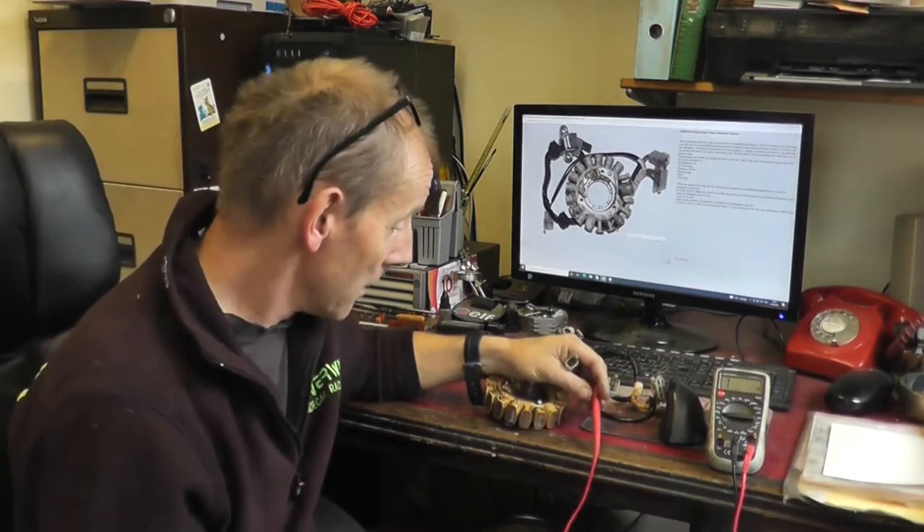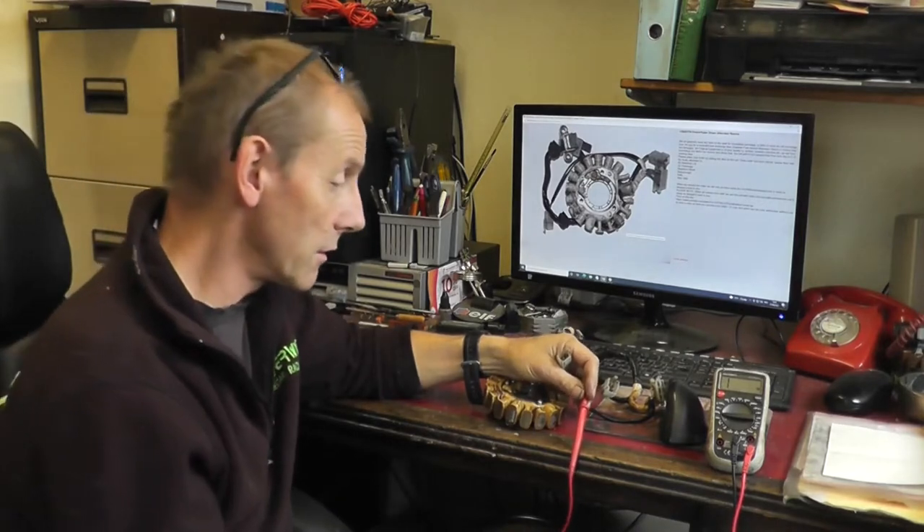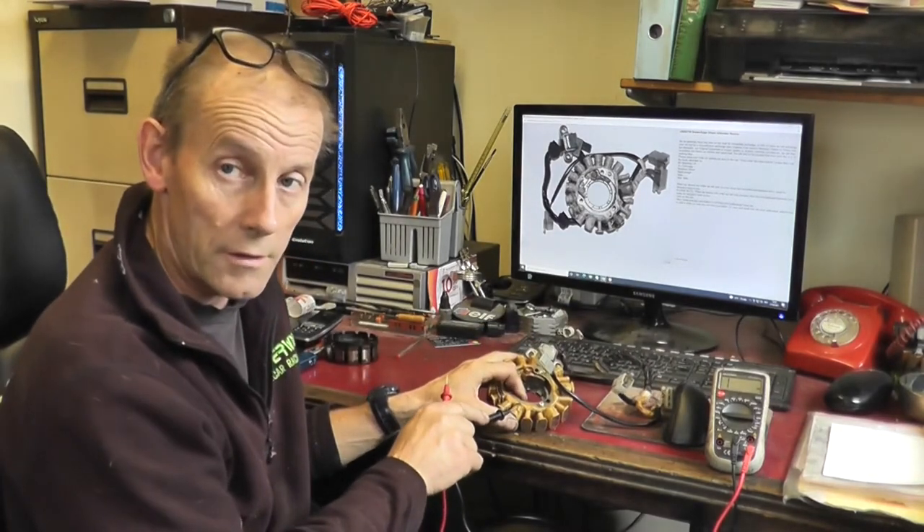However, I've been caught before — it's not always the case, and I'm not saying that's the case with this one. Those two cores, the low speed source cores, are actually joined to the high speed source core. There might not be anything wrong with those two cores. It could be the fact that the high speed source core is faulty, or the connections inside there are faulty. These run dry on these engines and suffer from moisture — corrosion gets in and starts breaking down the windings and shorting out. I'm suspecting the connection on here is grounding out slightly, giving a false reading on these two cores.